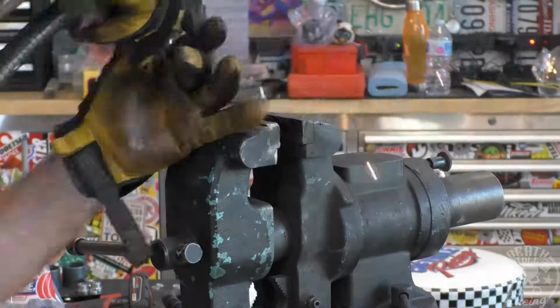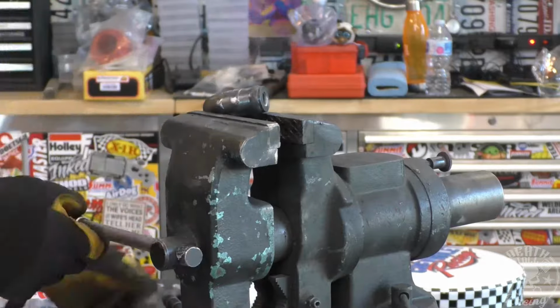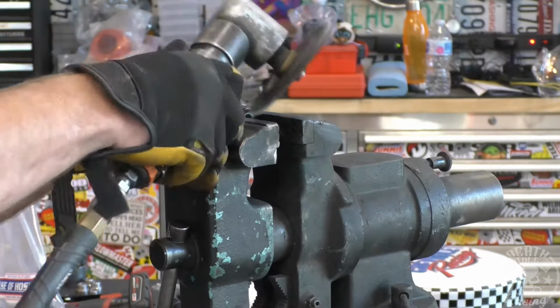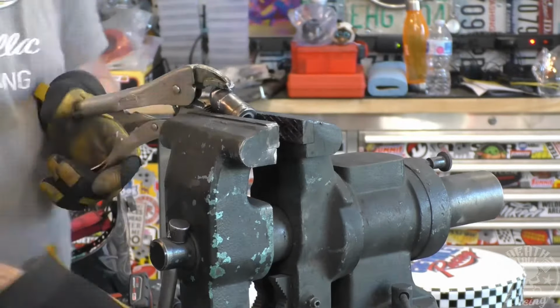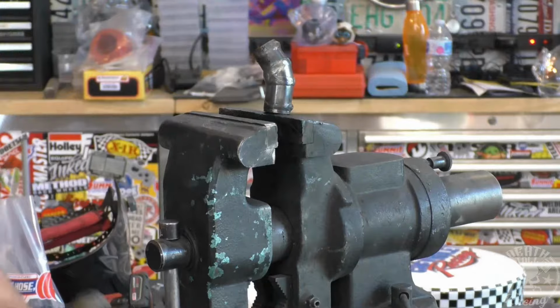So I got the weld all the way around on the other side, but we are going to use a weld as a gusset to try to transition the inside joint of that. Since there is going to be a lot of weight, it's going to be trying to straighten that joint out the entire time it's being used. So we're basically using a weld as a gusset on the inside.